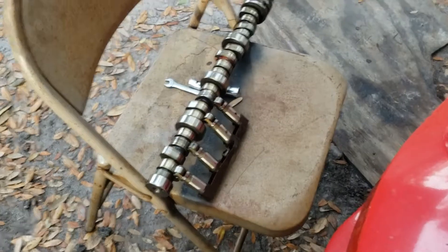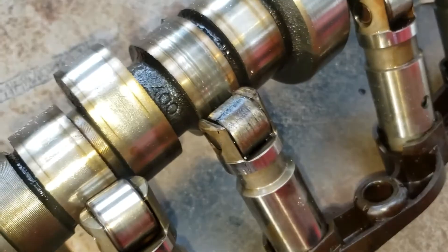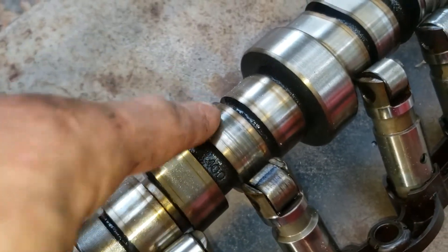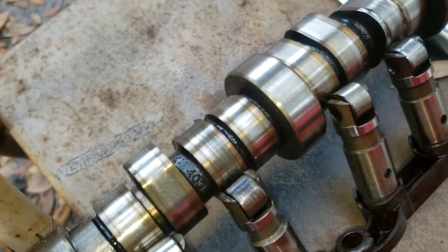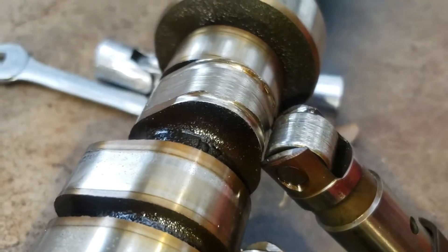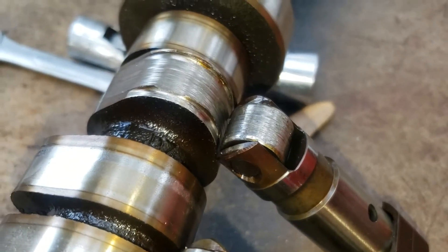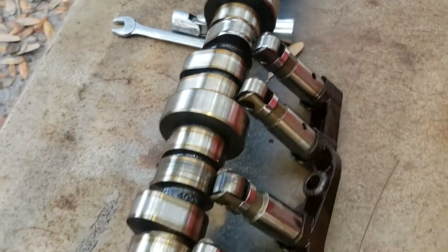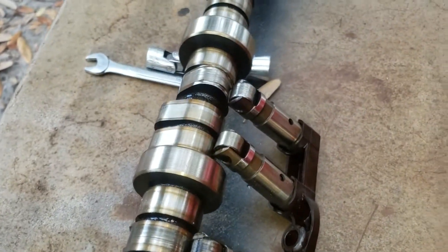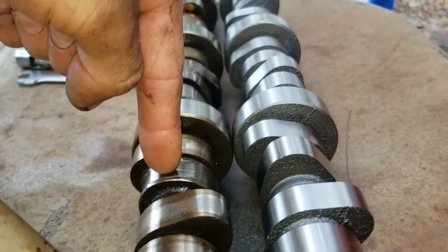Here we have the camshaft. The side that was bad was the passenger side — cylinder six and cylinder eight. You can see this roller is totally locked and has made the lobe actually round; there is no knuckle anymore, so this cylinder could not open or close. Cylinder six has a really deep groove — it still looks like a knuckle but it's just a matter of time before this one stops working and starts misfiring like cylinder eight did. The rest seems pretty okay, no damage to the other knuckles. Here's the new one side by side — you can see this knuckle right here.